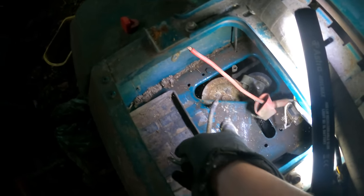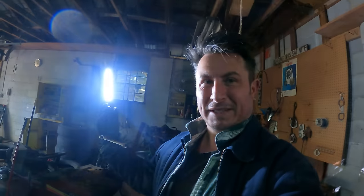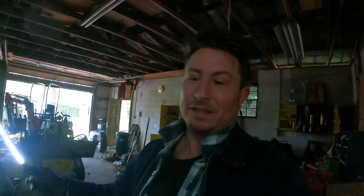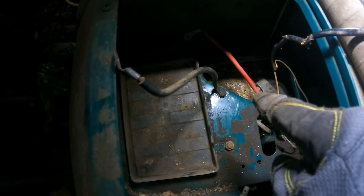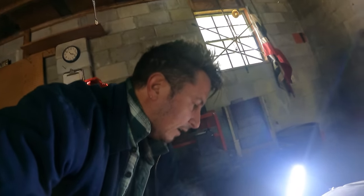Got the battery out. The ground goes straight to the body, the chassis, the whole thing — so if this ground isn't good, we're not getting anywhere. We're going to clean that up first. Fortunately I just tripped over this free wire brush — jackpot. You may notice my gloves. I'm not usually good about gloves in the shop, but we are in black widow country, and black widows want nothing to do with me just like I want nothing to do with them. I ruined their day a lot more than they ruined mine — they love hidey places and go to spots where there's no people until we show up.